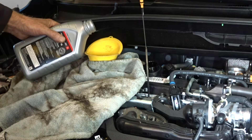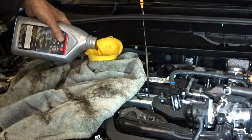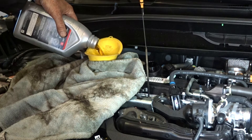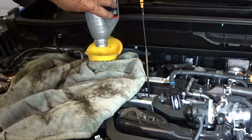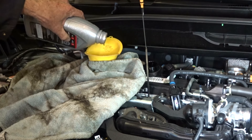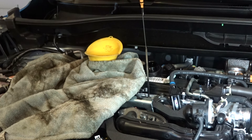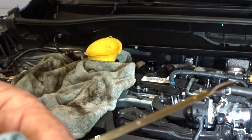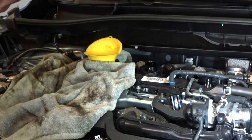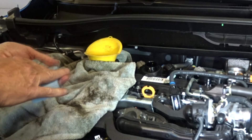Let's get the oil in. These bottles are one liter. The engine takes 4.2 liters when you replace the filter, although I don't know why they would give the other specification of 3.7 liters without a filter. I've put down an old rag to catch any possible drips because this car is brand new. 4 liters are in, and it's right on the full mark, which means that when I start the car the level should go down about 0.2 liters, so I'll need to add a little bit of that.